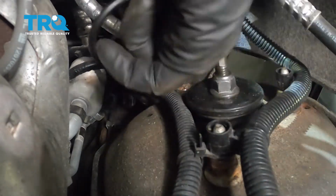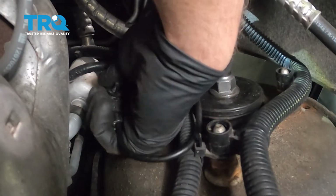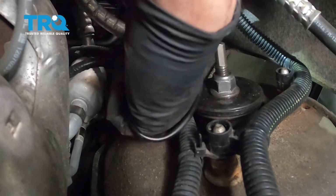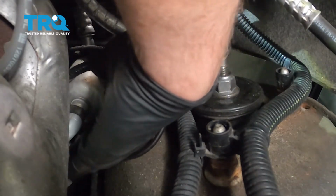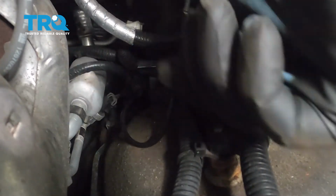And then find the connector for the top of the shock and connect that. Lock it down. And then there's a retainer on that. If you can get that back into where the retainer goes. Right back here. It goes right there. And that's all set.